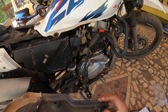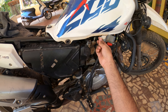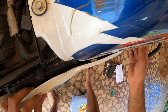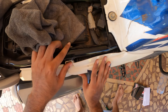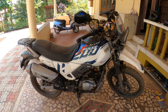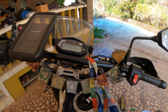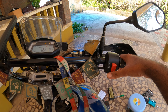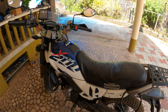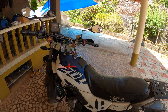Just make sure the lock fits properly. I lost one bush here — there's usually one bush but it's okay, I'll restore it as is. Tighten this bolt and screw and you're done with all the installation. Let's turn the bike on and see how it sounds. Let the ECU settle down for a couple of seconds to adjust for the new air filter.